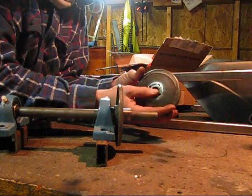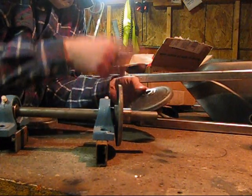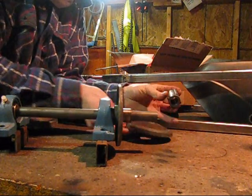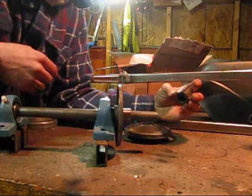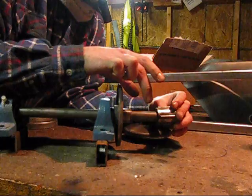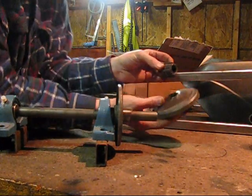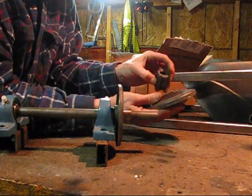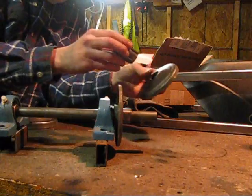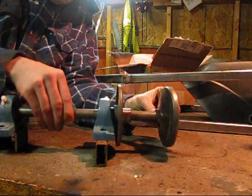Another culprit is like what I've got here — it's just gritty. There's just grit in there and stuff like that. When this is not engaging, or it's not disengaging, a lot of times it's because there's either grit inside of this thing or it's just getting too hot — there's not enough airflow to keep this thing cool. And that's what I've come across messing with these things.